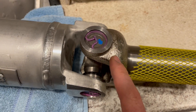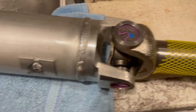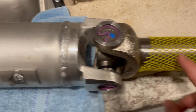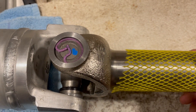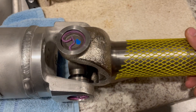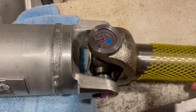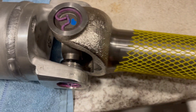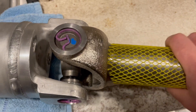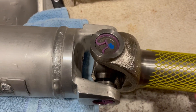I'm going to explain in a future video why that's a problem — but this explains how it happens and what you can do about it. The problem with the industry is that the driveshaft gets balanced on a state-of-the-art machine, laid in perfectly straight, and it tells the technician where to put the weight. But the u-joints are not in operation on that machine. There is no such machine that tests the operation of the u-joints. Only the customer, once they put it in the vehicle, will experience the shudder — and the shop keeps rebalancing it and can't figure it out.